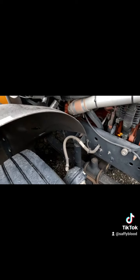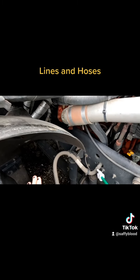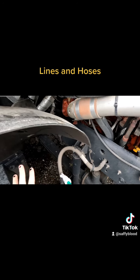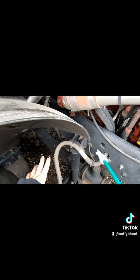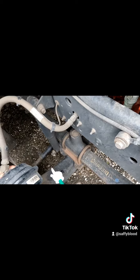We're checking the air brake components. We're checking our lines and hoses, making sure there's no damage like cuts, gouges, or weather rot, and that the fittings are secure with no leaks indicated by a hiss. We're checking our air brake canister, making sure it has no damage or aftermarket modifications. Then we're checking our safety clamp, making sure it is present with no bends or twists and is secured with its bolt.